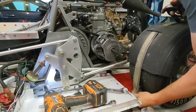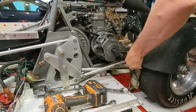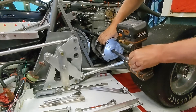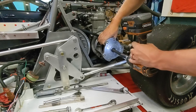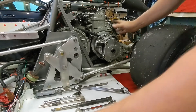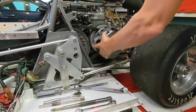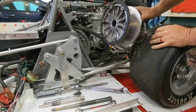I'm going to take my tire cover off here, I just need a little bit more space. Then back the clutch bolt back out. So now it's loose from the taper. I pulled my top four-link out of the way just to make this easier — this whole thing will usually kind of slip off and slide out. So there you go, that is taking the primary off.